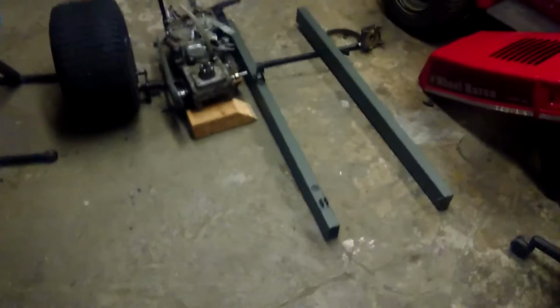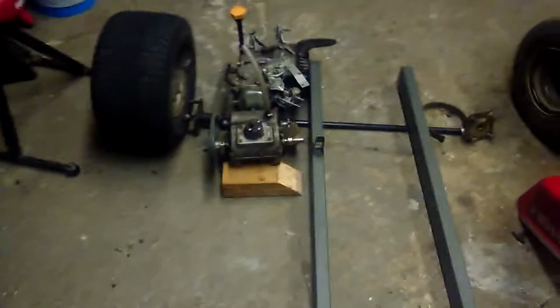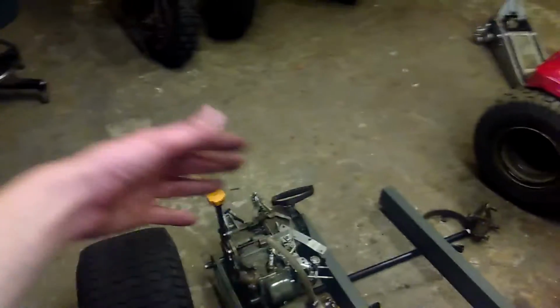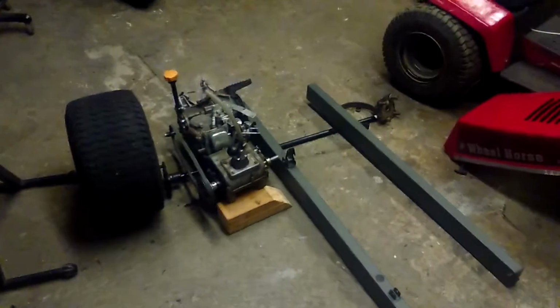Okay, this is a crazy video, a crazy idea, a new shifter cart idea. That's a mildly modded 212 Predator, 208 block, and 212 crank. Gives you much more compression, and you get more of an intake stroke as well.